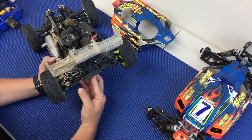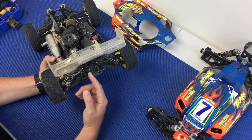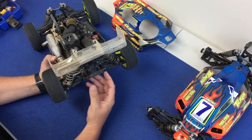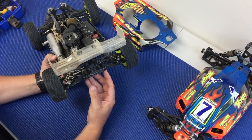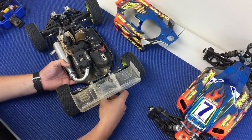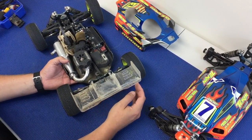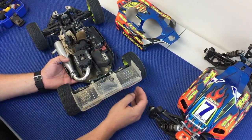Now, like most changes, it's not as simple as just a roll center adjustment. It also changes the amount of camber rise — and by that I mean as the vehicle goes through its suspension travel, more camber rise means there will be more change in camber.